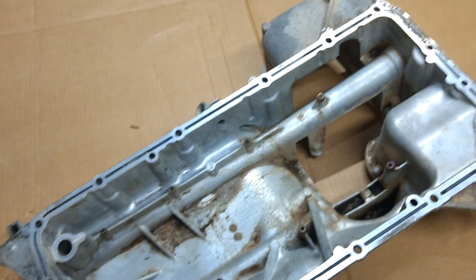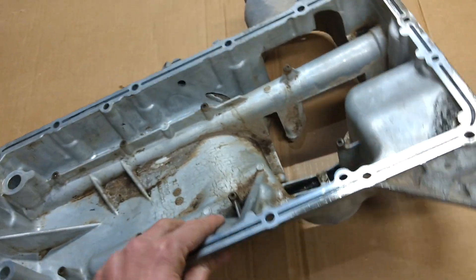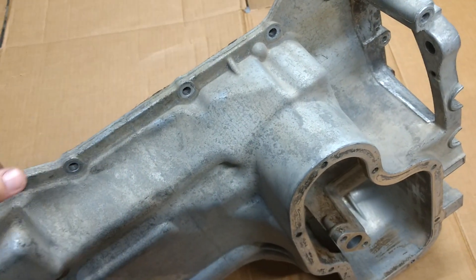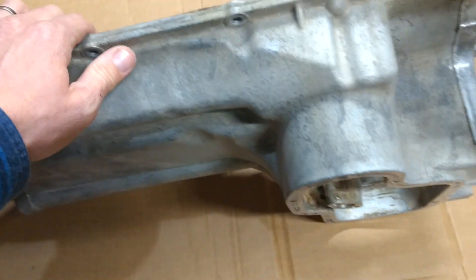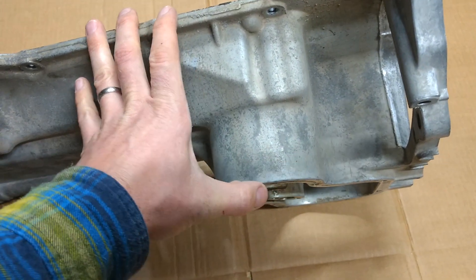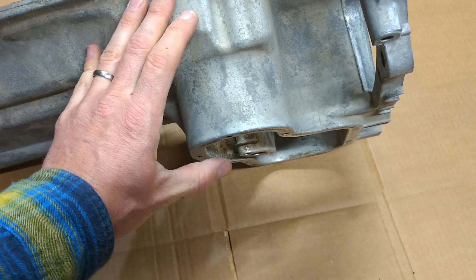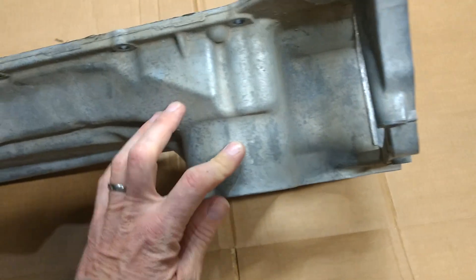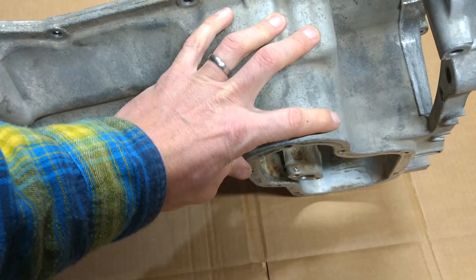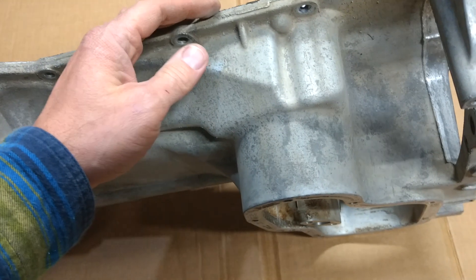Keeping all that in mind, that is why it really seems like the best course of action if you're doing this swap into an S chassis — your steering rack, right where my thumb's at, this stock VK rear sump extension on the pan plus all that steel hanging down is wanting to live in the same location as your steering rack. Not your crossmember, but your steering rack. A crossmember you can modify; a steering rack kind of has to be where it is.